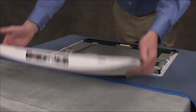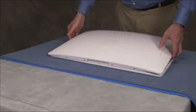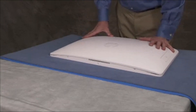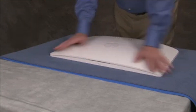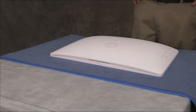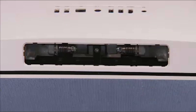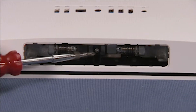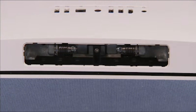To replace the rear cover assembly to the panel assembly, swing the bottom of the cover back around to align the cover over the panel assembly. Press all the hooked tabs and slots over each other until all have snapped into place. Replace the Phillips No. 2 screw in the stand attachment well area to secure the rear cover to the PC.